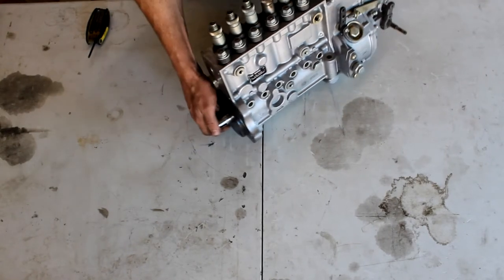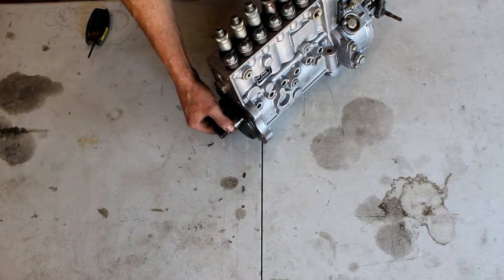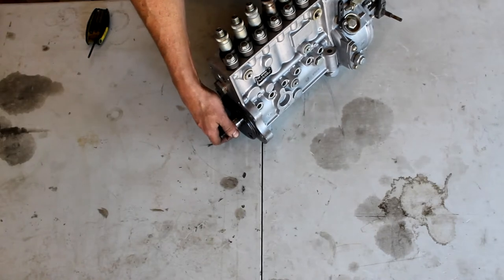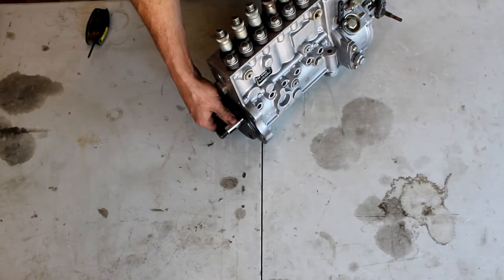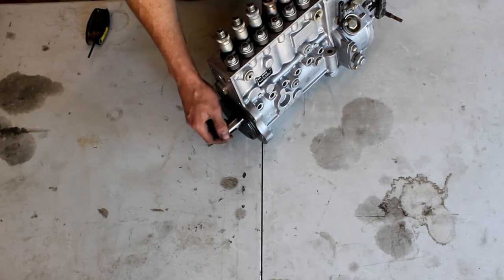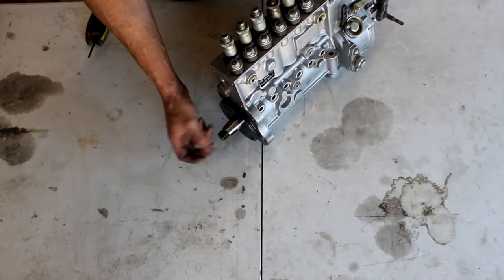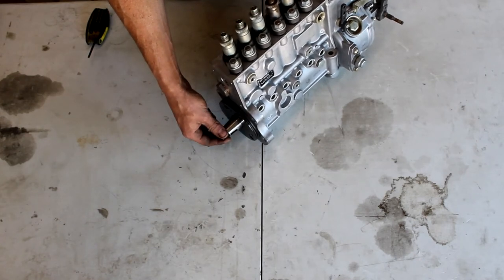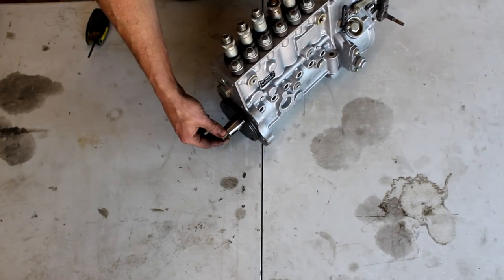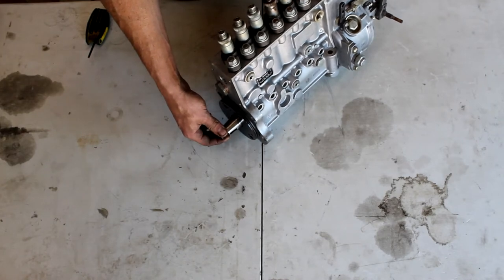There's a keyway in there. The keyway is only used in two situations: one, it's used for an adjustable pump gear; and two, it's used when on a pump bench so they can turn these things without having to tighten down the taper shaft to the proper torque spec. The torque spec we've been using for over six years when doing timing changes is 165 foot-pounds. We brake clean the gear and snout as best we can — just don't go overkill, as it can soften RTV and cause leaks if you have an RTV front cover.